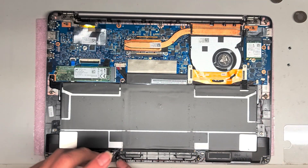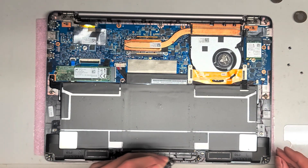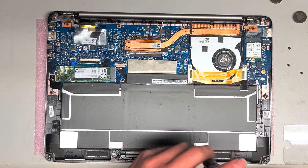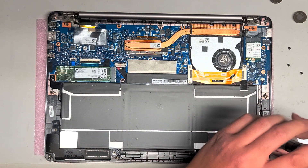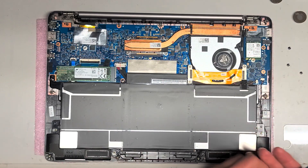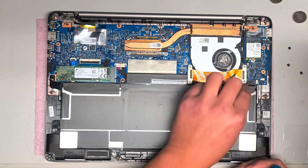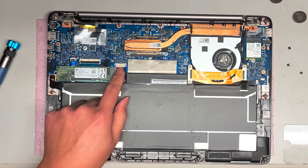So we'll take out those two screws there, then there's two screws at the bottom, and two screws along the sides. Looks like one screw is covered by this cable — I'll probably have to take that connector out as well. To be safe, I'm going to disconnect the battery and then press and hold the power button first.